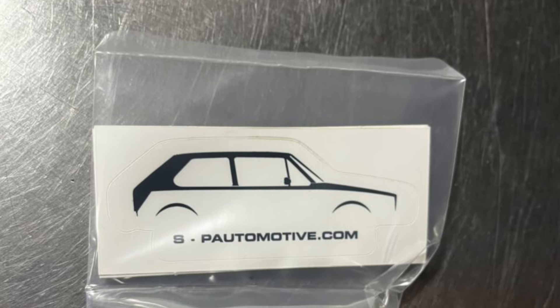These SP radiators are great — I've been running one on my car with no overheating issues at all. This also includes all the necessary radiator hoses and a tach adapter. Mark 3s use a digital tach signal whereas Mark 1s have an analog signal, so the tach adapter converts that signal so the tachometer reads accurately. It also adapts the four-cylinder tachometer to the six-cylinder reading from the engine computer. Next is the secondary air injection delete, which is $19.